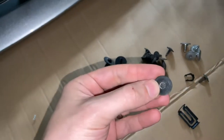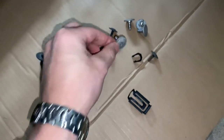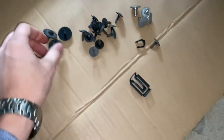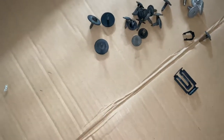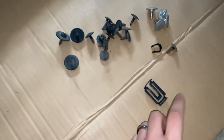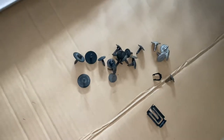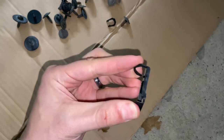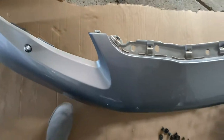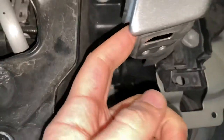These are T25 bolts all the way around on the bottom and on the sides of the wheel wells. Up on top you have T30 bolts — they look like aluminum versus some kind of steel. These are on the bottom as well, just different ones, the same one but with washers. The bumper retainer clips are important — you pull up on each side and that'll pull this part off, which connects to the fender right here.